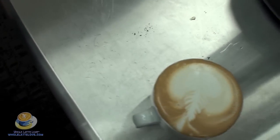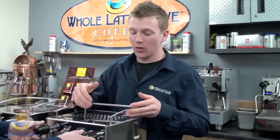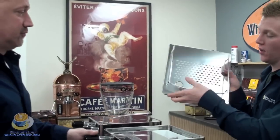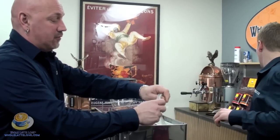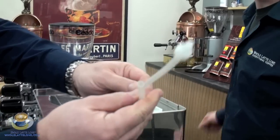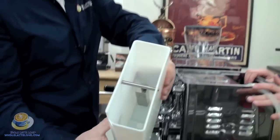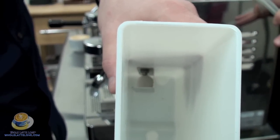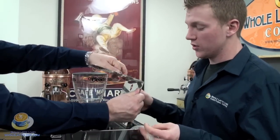There you have it. Now that we have showed you what the machine can do, let's take a look at the internals. There's a passive cup warmer on top — this removes. You can actually fill your water reservoir through this hole, or you can move the entire thing out to fill it that way. Here's your fill tube — it comes with a big particle filter on the end, and the other is the return line from the OPV valve. You do have your water reservoir, 90 ounces. It has a float in there where the electrical sensor — when you run out of water, it actually kills the heating element so that you're not going to burn out your heating element with no water in the boiler.